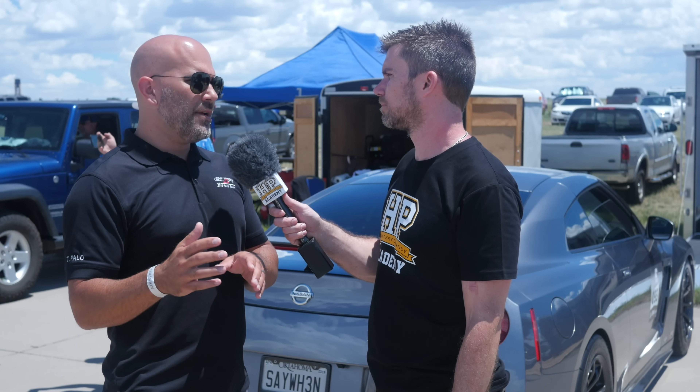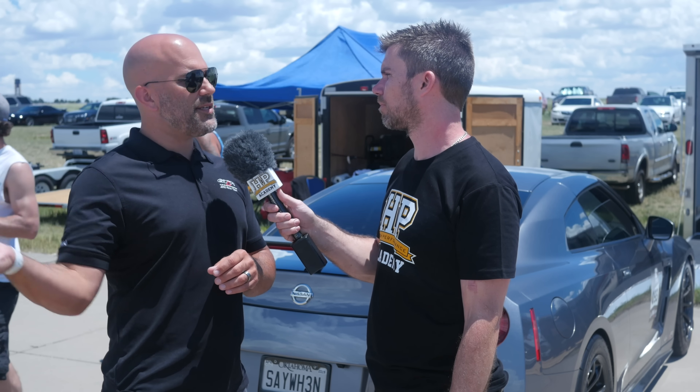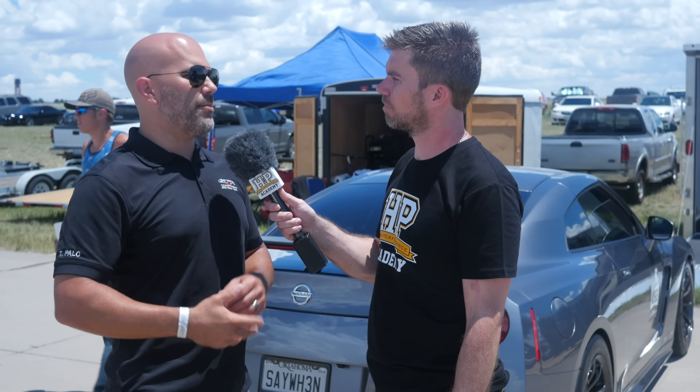We'll use the TCM request in full at lower torque, so drivability is just like stock. And then at higher power, we have a threshold above 500 to 800 foot pounds of torque where we go to a full M1 based strategy that is initiated by the TCM requesting, and then it's all on board in the M1.